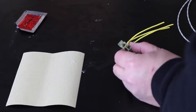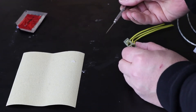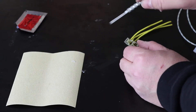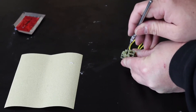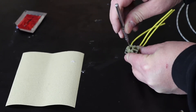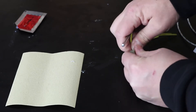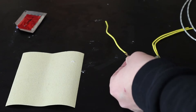For this style and most styles of connectors, you need a sharp tool — either a really small flathead screwdriver or a pick like this — to de-pin them. Most connectors have a very small plastic tab inside that locks the terminal in place. With this style, I would push the pick in and lift up on the plastic tab while pulling from the back to remove it.